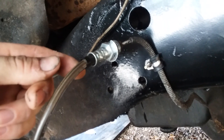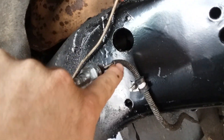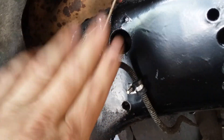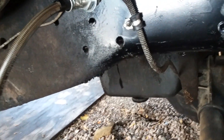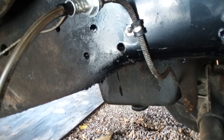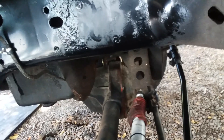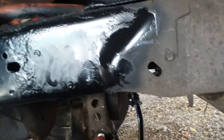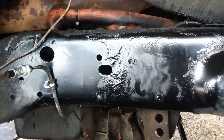That's really not the best mount though, just for the simple fact that if it ever flexes too much there's nothing here supporting it, so it could bend right here. I am going to do a proper mount for this as well — just haven't got around to it. I wanted to get it driveable so I could run around town and make sure everything's gonna work out. I'll shave this side as well and put the four-wheel drive spring perch on.